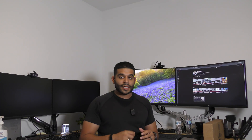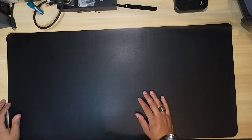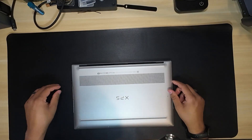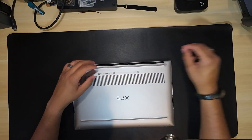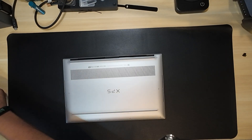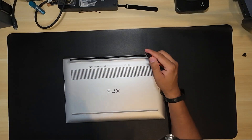Let's head over to the computer table. We'll take apart the computer, take apart the battery, and I'll show you in detail what we do with that cable. Then we'll put the new battery in, close up the computer, and you guys should be experts at that point. First thing we're going to do is remove any removable items from the computer, such as the YubiKey. Next is removing the eight T5 torx screws on the computer using this precision screwdriver kit — links will be in the description.